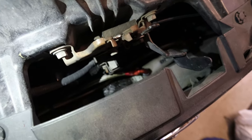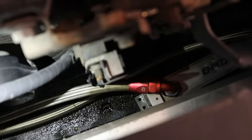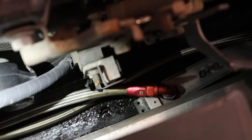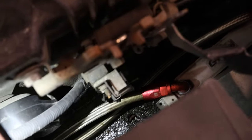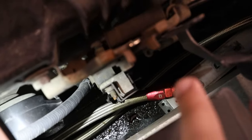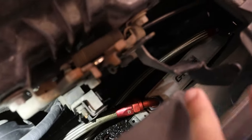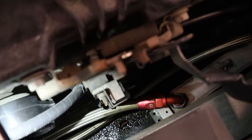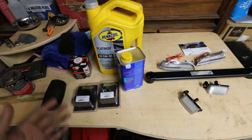There's oil on the bottom and I think it's leaking from that fitting right there. These generic AN fittings are just not good, so I'm going to be replacing them with a really good brand. I tried skipping out initially and only replacing the ones on the oil filter side, but these are also going to need to be replaced, so I'll be replacing them with Russell fittings to take care of that leak.